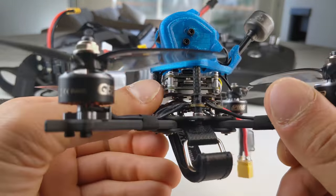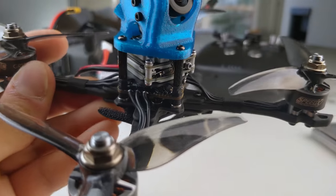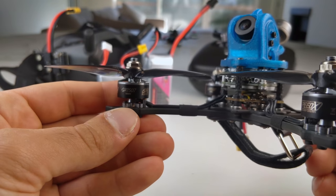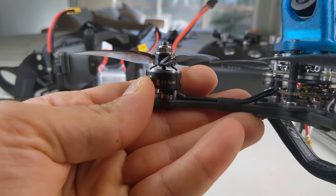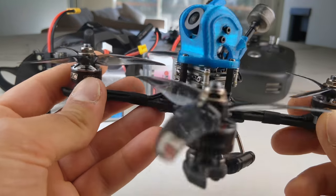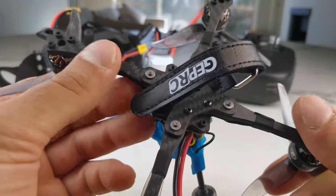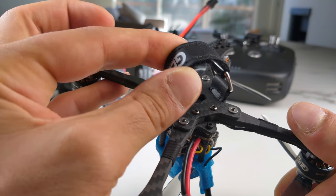Let's take a quick look at the quad. As I described, it does have that Vista unit crammed on top — you can see the video cable there, genuinely crammed in. Not really confident in surviving crashes. The motors are 1507, 3200 KV motors — definitely good for 4S and good for 3S as well, though on 3S I'd prefer just a tad more KV. The frame has 4mm arms, 2mm body plates, 2mm screws holding the arms, and the battery strap goes through really nicely.